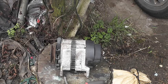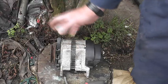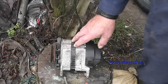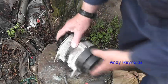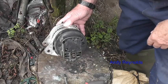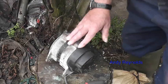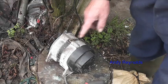I've done a few videos about the International 684 tractor that I picked up a few years ago. It was a bit rough, and before I bought it I put a meter on the battery and it was showing 17 volts, so I knew we had a duff alternator — hence we were able to knock a bit off the price. This is a Lucas ACR alternator, and on the back there are two positive connections. That smaller connection is the one that comes from the ignition warning light through to the regulator. Because it was showing high voltage, we knew the regulator was faulty.